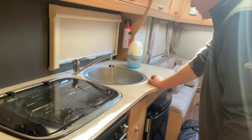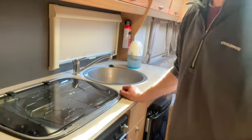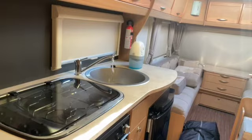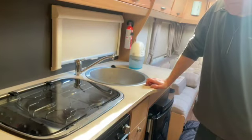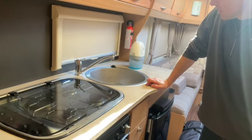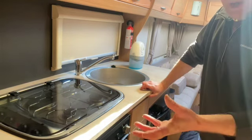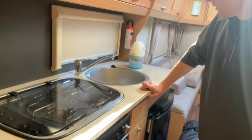While it's doing that, stand back and check around. Pop into the bathroom and check it's doing it in there as well. If you have it on hot, you know you're filling up the hot tank. It'll take about 30 seconds or so to fill up as it normally does. You're filling up the tank with the sterilizing agent and also filling up all the pipes, so don't forget to go into the bathroom tap as well so those pipes fill up — the whole system, all of the water.